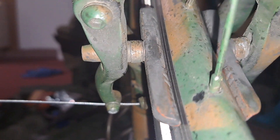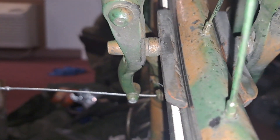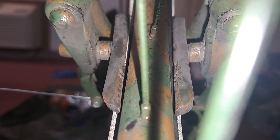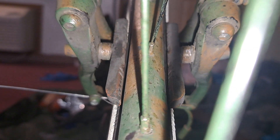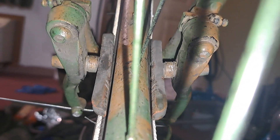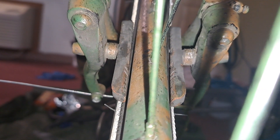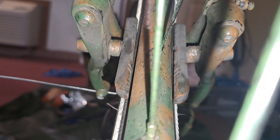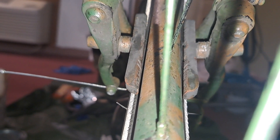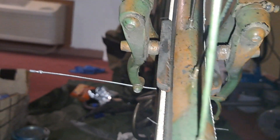One more look at the brakes again. We can see it's fairly straight — it's not bad, the distance is about even. This other one is about the same. So these top adjustment screws will pull them left or right. I want to have them just about centered with a little space. My wheel is out a little bit, so there's probably more space than what I need, but it seems decent enough for what I'm doing right now.